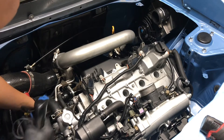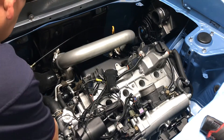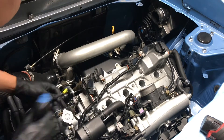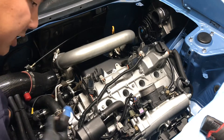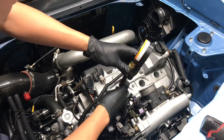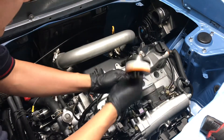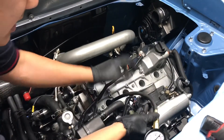Go ahead and attach that. Instead of cranking the car by yourself — you could do that too — you go in the car, stick the compression tool in the cylinder, twist it in, and get a camera or someone in the back. Pretty much let it sit there and then crank the engine.